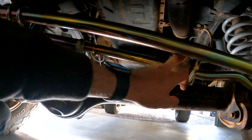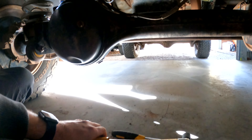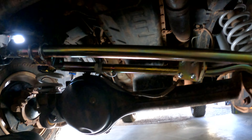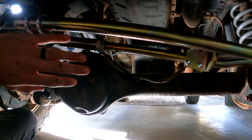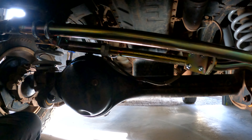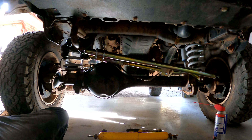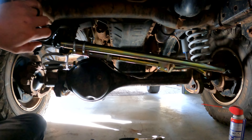Alright, we're on the steering dampener. I've fitted the universal brackets from Superior — just L-brackets with U-bolts. I had marked my shock setting earlier, so I set them out to that setting. Make sure your shock is straight, bracket to bracket, so it doesn't twist with the movements and articulation of the vehicle. It's not a hard step — just use Google and the fitting instructions from the manufacturer and you'll get there.